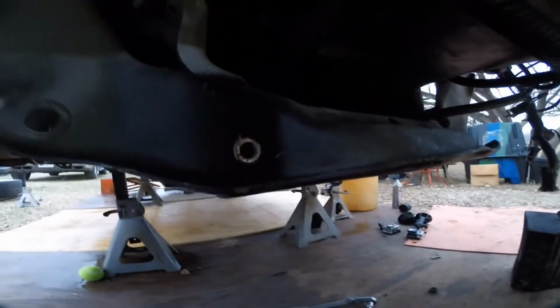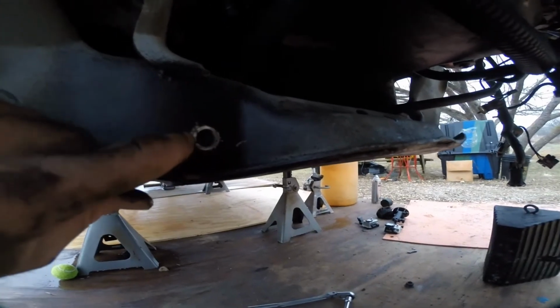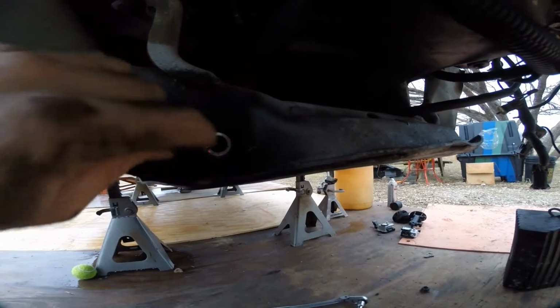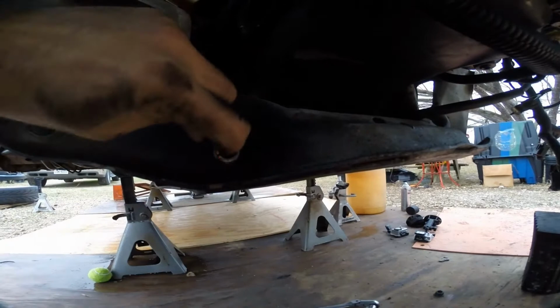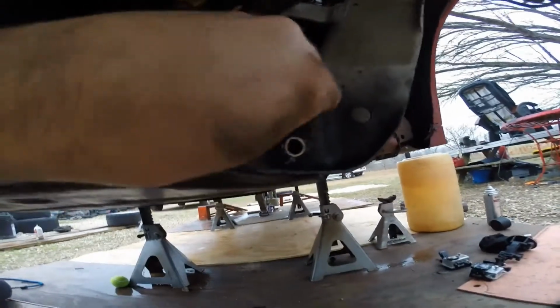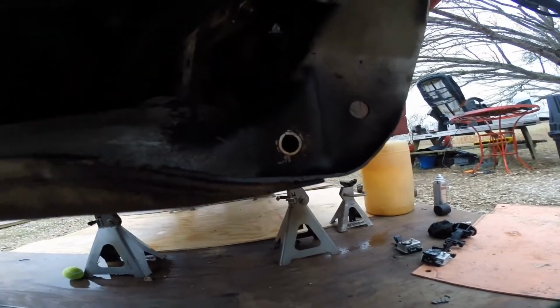Bushing sleeves are in there and cut down and used a flat disc, and you can just grab your fingernail so they're recessed just a little bit. Get your fingernail and it'll catch it. So that's what they were asking for, not to be flush but recessed slightly. Same over here. So that's exactly what you're looking for.